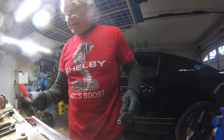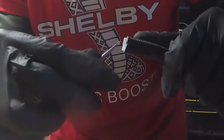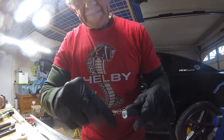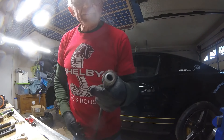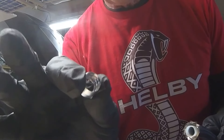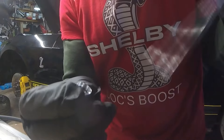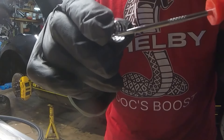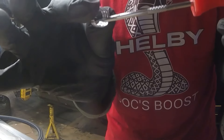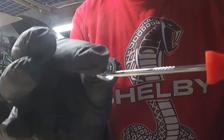Take a sharp pick and work the edges of that hose away from the Teflon core, pushing it back and up at the same time. Be careful not to poke or damage the Teflon core while you're doing it. Now I have the ferrule — you can see the ridges in there, and those ridges are what creates the seal. Right there is the edge where the Teflon tube is going to butt right up against that surface.